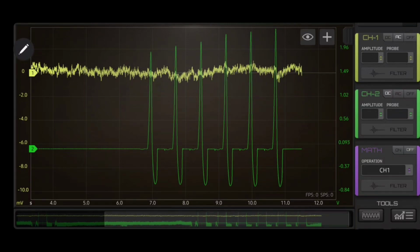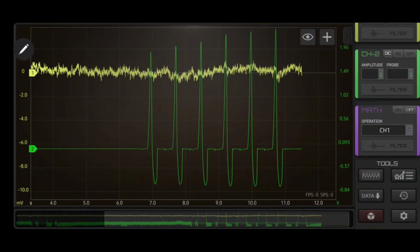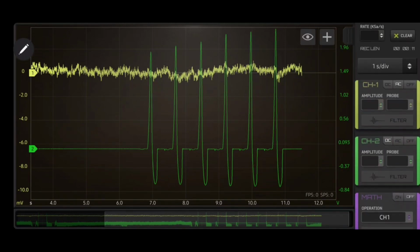And as you can see, it's the same battery and starter that would have cranked over the car. So I should definitely have an intake pull right here, and I do not. So that's a clear sign the engine is junk, and it's further confirmed by the mechanical gauge. So I thought that was cool to share with you guys too.